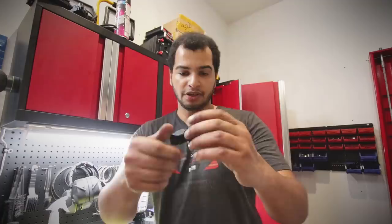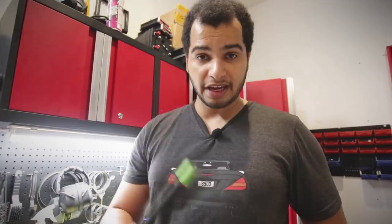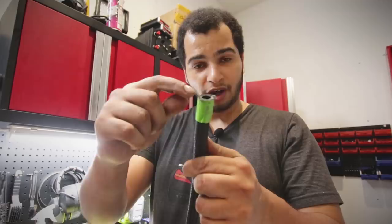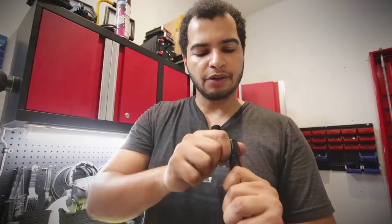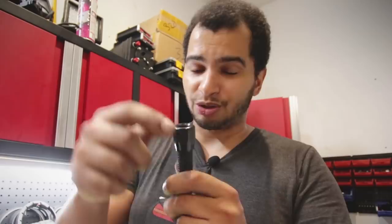This is a regular hose end — a dash-8, so it's in two pieces: the collar and what you screw into the collar. Take your length of hose and put a little bit of tape — electrical tape or masking tape — right where you're cutting, because you don't want the frayed stainless steel ends to go everywhere. You don't want it to balloon out. After cutting, take the tape off, then place your collar over the hose. There's a little bit of resistance sometimes. It should go all the way up to the threads — you don't want it going into the threads, but just at the threads is perfectly fine.